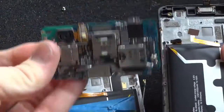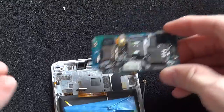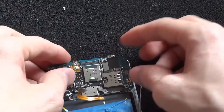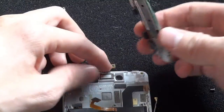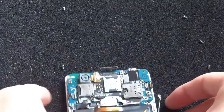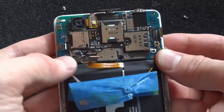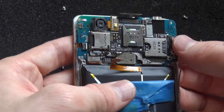You don't need to take off the camera part because it's connected onto the motherboard. I want to take this one and put it back into place. Put it down and make sure all the connectors are out of the way so they can be plugged back in. The battery should probably be the first thing to take off and the last to put back on, just to be safe.